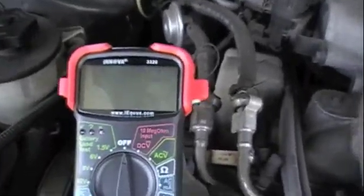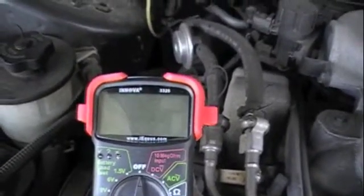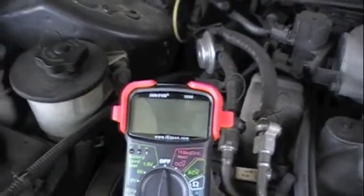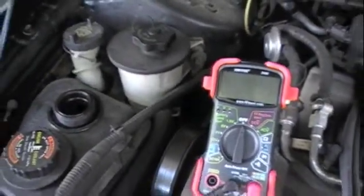You're going to check what the voltage reads when they rev the engine to 2000 RPM. If it's above 0.4 volts, your coolant's old — it's broken down and it's doing damage. If it's below 0.4 you're okay, although it might still be recommended that you do a flush anyway, just because maybe you've driven over 30,000 miles, or whatever the interval is for your car.